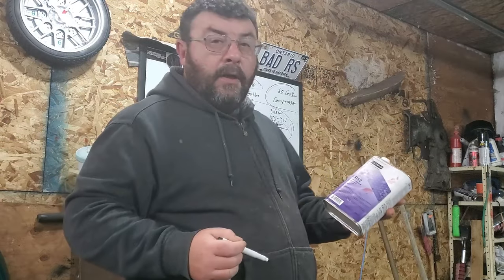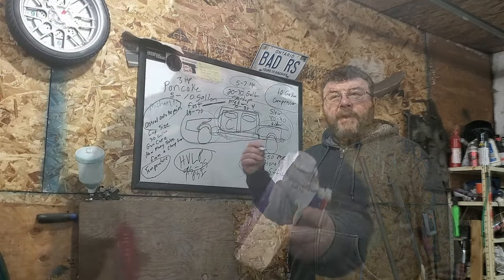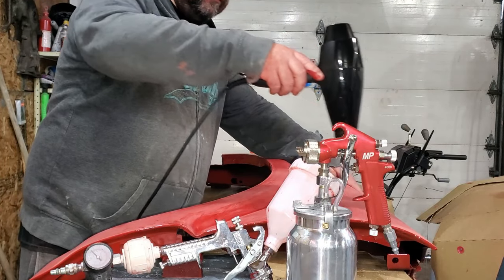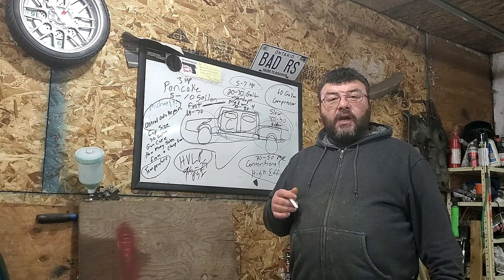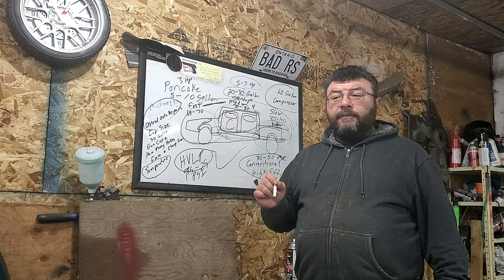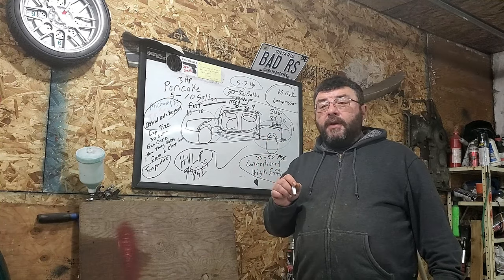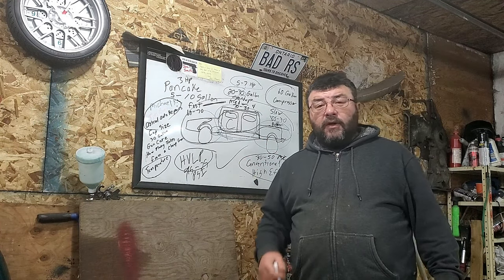As far as temperature goes, you want to pick a solvent that works at the temperature you're going to be painting at. A good hint is to warm up the panels before painting if you're working in a cold environment. If you have a cold panel and you're putting paint on that's at room temperature, you're going to get a sag, and a run will just ruin your day. I'd like to thank Michael K and Astral Auto Repairs for the questions — hopefully this answered them. If you have any other questions, leave them in the comment section below.